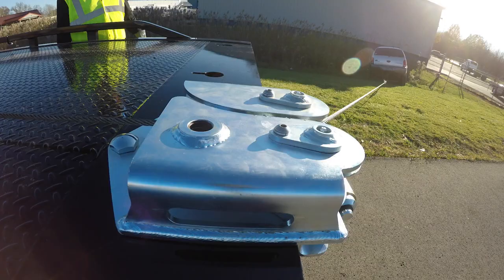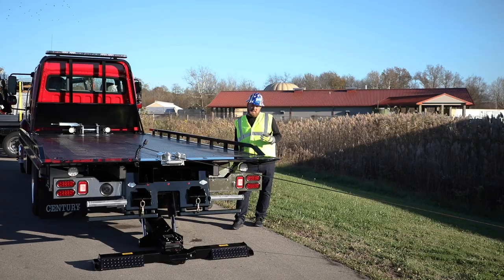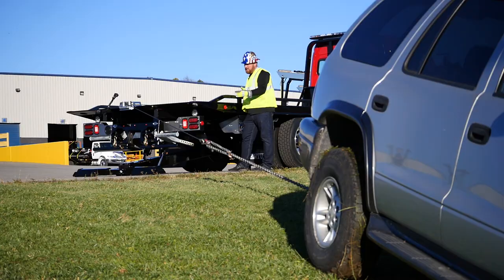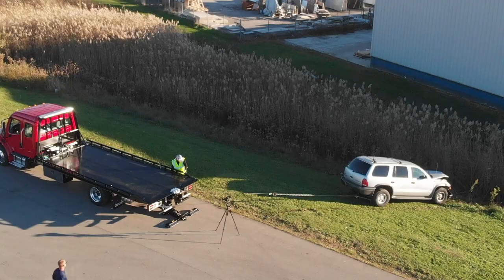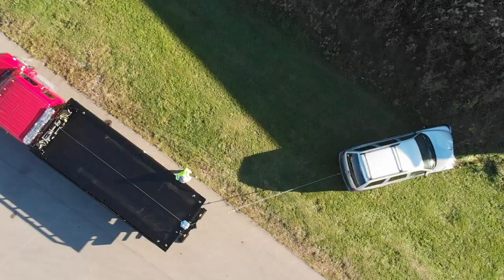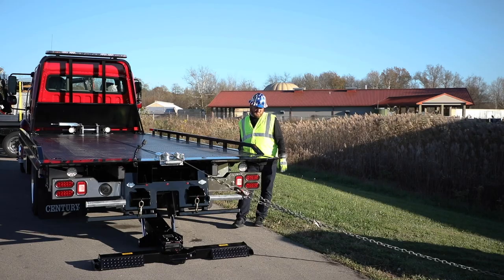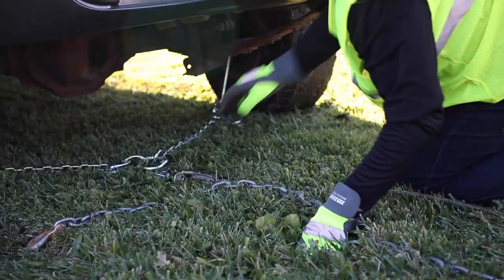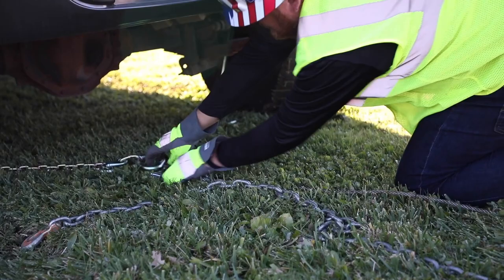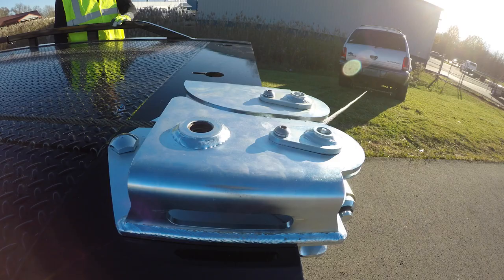Simply engage the winch — as you can see, the wire rope is going through the device and the roller is rolling just fine. There is a grease fitting on top; you'll want to keep that well maintained. Make sure you're not getting into the carrier bed while winching and that the wheel lift is down for stability. This thing is pulling the Durango out without any issue. I'll pull it up as far as the wire rope allows, freewheel the winch, put it back out to the bridle, and keep winching up to the edge of the road. The device works perfectly.